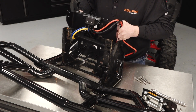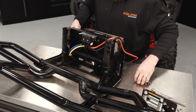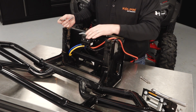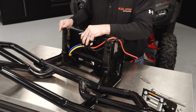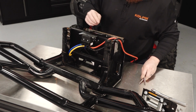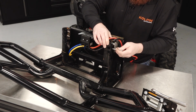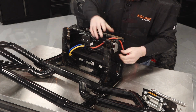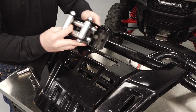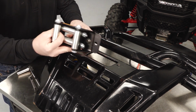We'll slide the winch assembly into the bumper frame as shown, and then we'll grab the upper fasteners from each side, the 2 uppers, and then we'll slide them into the holes as temporary alignment pins. With the bumper and winch assembly temporarily aligned, we'll install the roller Fairlead. We'll want to keep the warning decal up top.